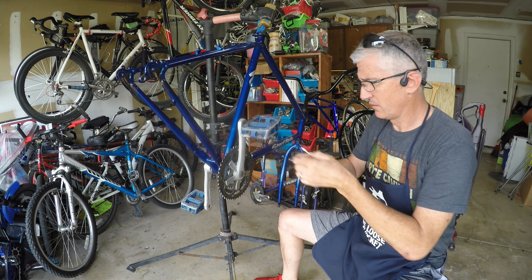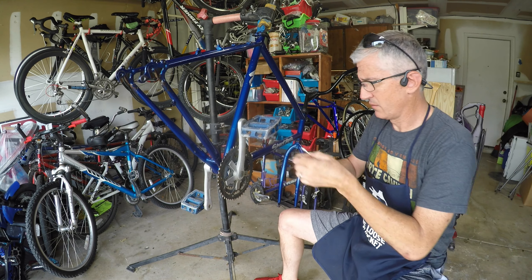I lost the video of me mounting the rear derailleur on the bike, unfortunately. I then started on the front derailleur — it just needed cleaning, nothing mechanically incorrect. There were just so many corners and nooks and crannies to deal with. I used my Dremel with a fine point attachment to reach hidden areas, along with Q-tips for certain spots, though they're not precise enough for everything. Wire brushes can only get so far, so it's not 100%, but you clean them up as best you can and get them ready to mount.